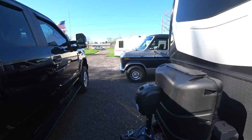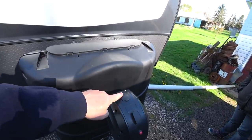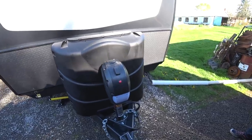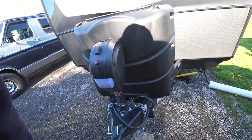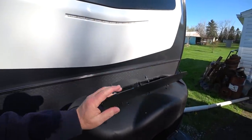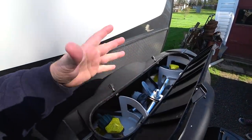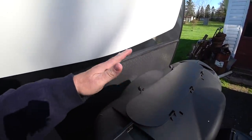This does come with a relatively nice power jack — 3,500 pounds rated. It gives you a seven-pin plug holder on the side of the RV direct from Rockwood, which is very nice. You also get two 30-pound propane tanks with an automatic switch-over regulator, just like you'd expect on newer RVs. You can choose which tank to draw from so you don't have to disconnect and shut off your propane just to refill one — you just flip it over to the one you want.